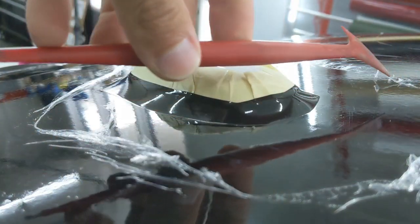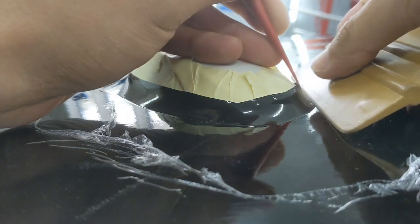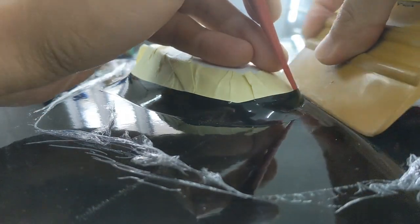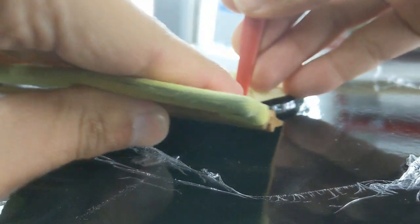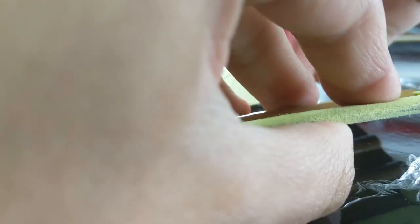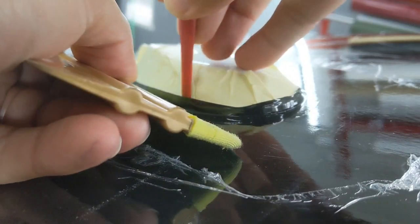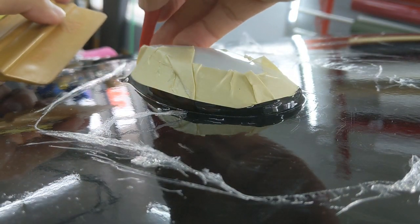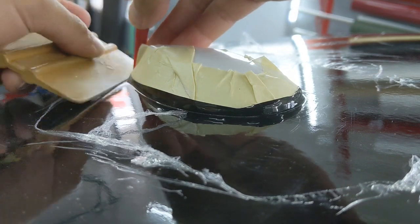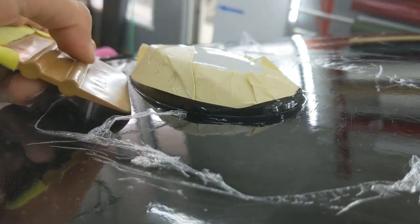So I've got this Avery Dennison Flex Stream. Basically, it's going to be releasing the film from around the antenna and then just tucking it into the base, getting rid of all that tension that you've got there. Just making sure you get a good tuck all the way around. Being extremely careful on the back over here because it's really pointy and could tear the film pretty easily.